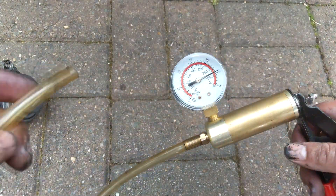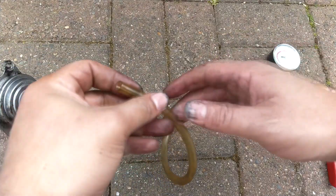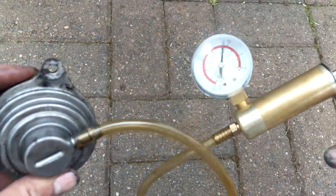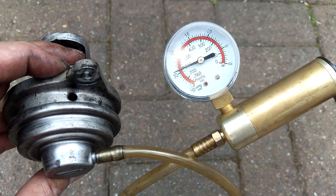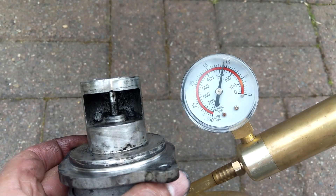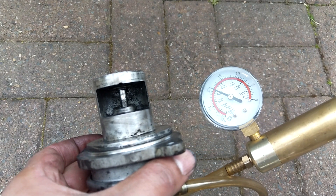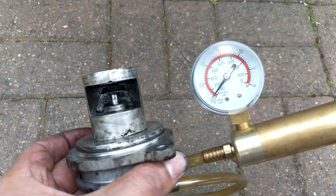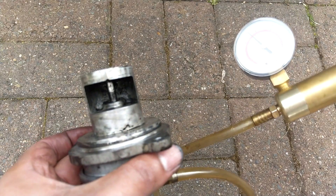So then I managed to finally fix my vacuum tester, although zero is now at five, so it's over-reading. But if zero is at five, then at 15 inches of mercury it will actuate the valve. And not only that, I was able to do it so the vacuum tester now holds vacuum, so I was able to properly test the actuator — that it can actually hold vacuum. And as you can see, once vacuum is built up, the actuator holds it. That's one of the first tests — if you've got one of these vacuum actuators, that's one of the first tests you need to do with it still on the car. Because if it's not able to hold vacuum, you may as well buy a new actuator, because you're not going to be taking this apart to repair the diaphragm inside. Whereas on the car, if it does hold vacuum, then you hopefully shouldn't need to actually replace it — you can just take it off the car, clean it up and free up the movement, and it should restore the operation exactly like this has done.